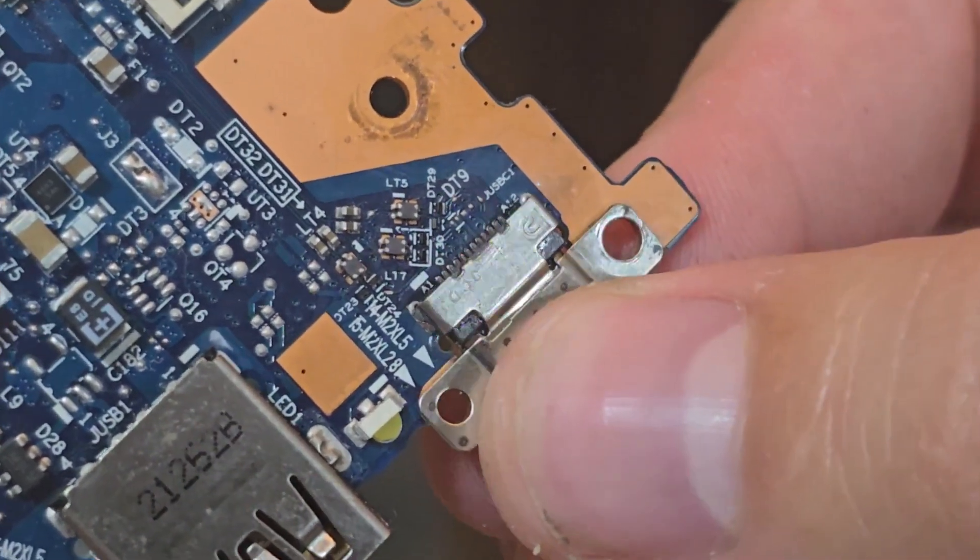I have put a little bit of low melting solder on there, and I am using a heat gun to heat the PCB and connect the USB-C port with the PCB. I am cleaning it around, and now test fitting this USB-C port.